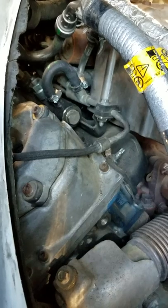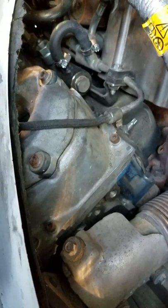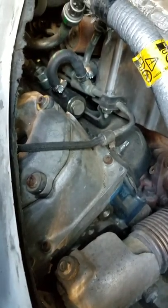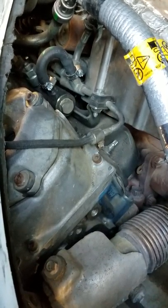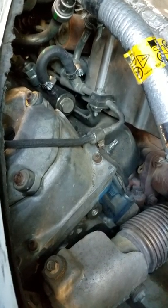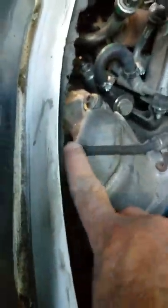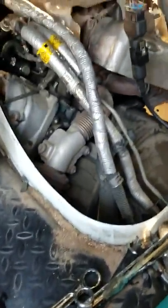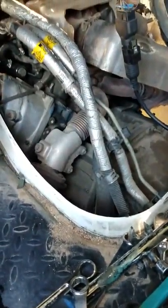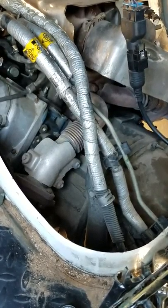There was one that came in about two years ago where none of the balance rates pointed to it — one was actually showing good balance rates. So they're not always right, but most of the time the balance rate will show you the injector with a ball-and-seat problem that's returning high pressure fuel back to the tank through the return line. Anyway, I hope this video helps you out. If you have any questions, reach me at duramaxtech@hotmail.com. Thanks for watching — give me a thumbs up, I appreciate it!